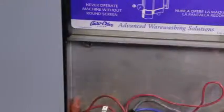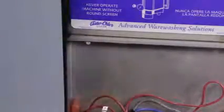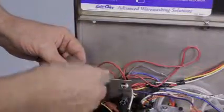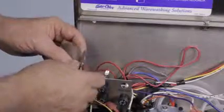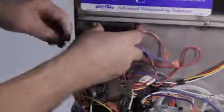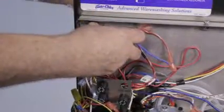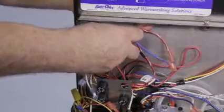Install switch relay in the top left corner of the chemical case. Utilize existing mounting bolt with supplied bracket and spacers. For models without this mounting bolt, installation will be required using a 1/4 inch 20 by 1/2 inch bolt and nut. The bolt hole is to be centered 3/8 of an inch down from the inside edge and 1 inch across from the inside edge.